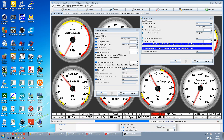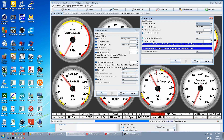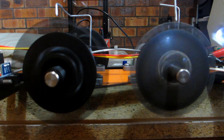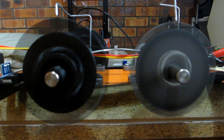Leaving everything the same, we change this now to sequential. Burn that. We remove our missing tooth so it's uninterrupted and restart. Checking the result: crank top dead center, compression top dead center, no overlap top dead center. Sequential missing tooth is correct.